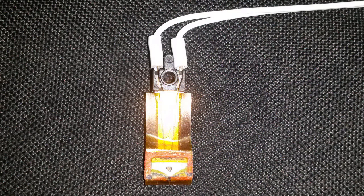The thermistor provides feedback to the microprocessor to turn the halogen lamp on and off and keep the temperature within range. The thermostat is the safety backup in case everything else fails. The reason there are two thermistors and two thermostats is to balance both sides of the drum — the halogen tubes are wound more tightly on one side, staggered, allowing independent control of each side. Xerox is a brilliant company and the testing likely confirmed this is the best approach.